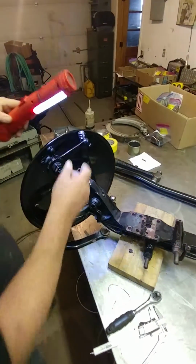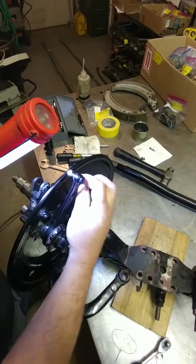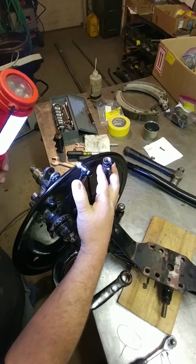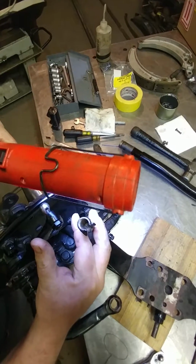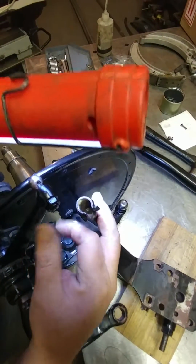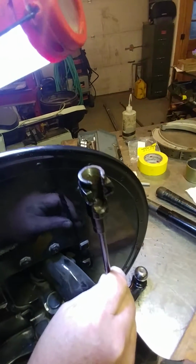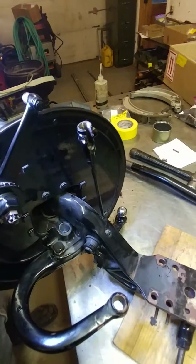One of the first things we'll look at is this very simple ball mechanism. We've measured it. It's actually only about 3 thou out of round, which can be polished out. But if we look down inside the socket, there's a lot of sand, dried rust, dried grease, largely a cleaning exercise. We haven't checked the bottom one. There's a little play in it, but that may be able to be taken up with the threads.